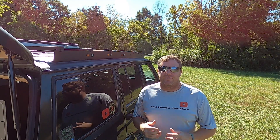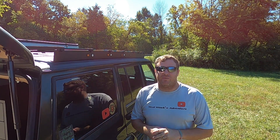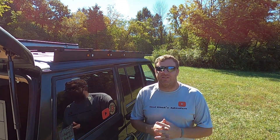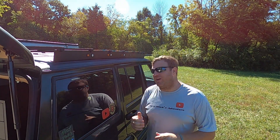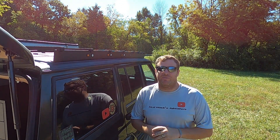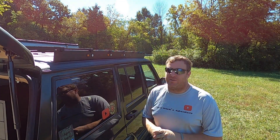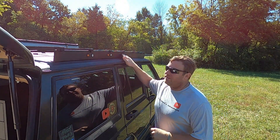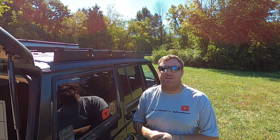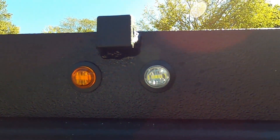When you're out camping by yourself and there's not much lighting, I wanted to have additional lighting on the sides of the Jeep and on the back. When I'm out in the middle of nowhere I can flick these on — they're real low wattage, low amperage LEDs so they won't draw a lot of power. I'm still running just a single battery up front and can run them all night with no problems. What I did was add three amber lights and three white lights per side — these are all inch-and-a-half slip-in lights. They're super tiny but they really do put out a good amount of light.